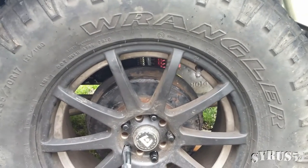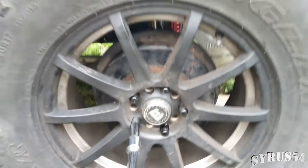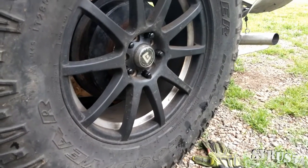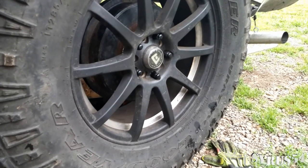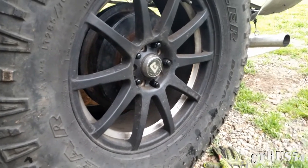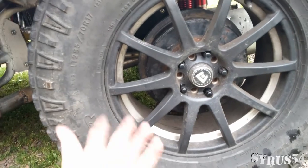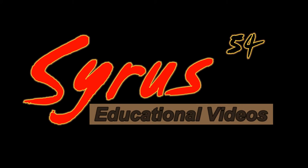After you've gotten your lug nuts tightened down, drive around for one to five miles, then pull over and re-tighten your lugs. If you don't do that, you risk that the wheel stud is not going to seat into the rotor properly, it's going to come back out, or your lug nut is going to come flying off while you're driving. That will start loosening the tension on the other lug nuts and they'll all start coming off — then you're going to lose a wheel on the highway. It's up to you whether you want to do it the right way or just risk it.